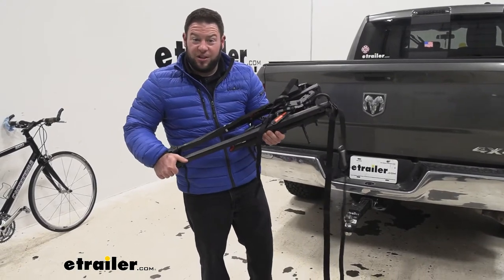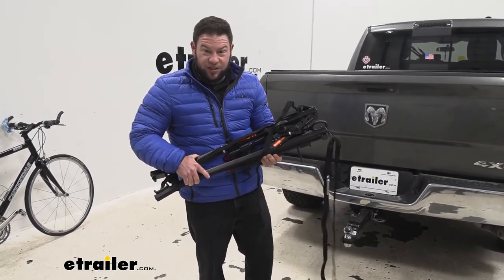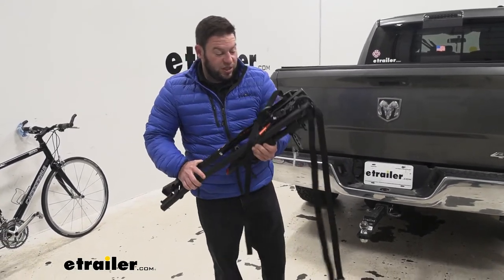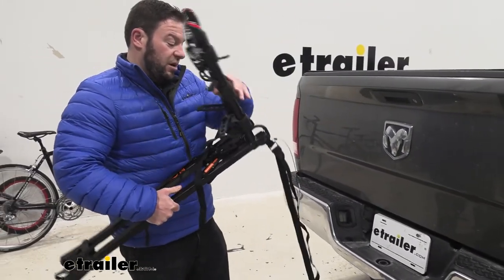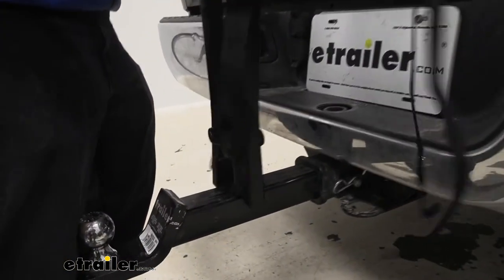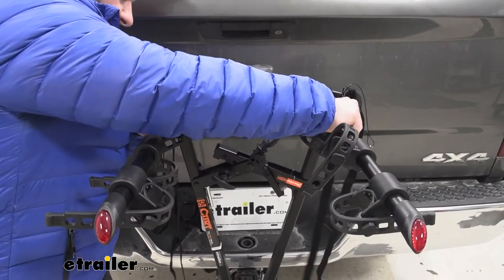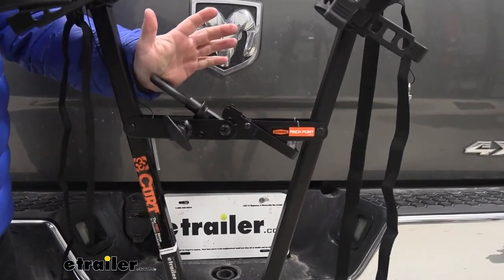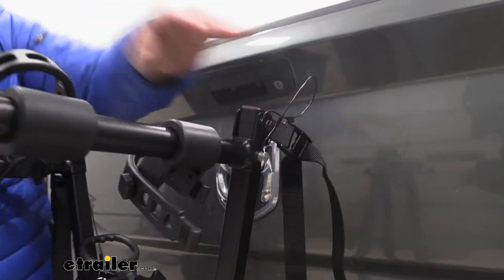Went ahead and removed the bike and took this off because I want to show you how easily this installs. First off, this is how compact it gets — it gets pretty small, which is good because you can easily put it in your garage for storage, the back of your vehicle, or even the rig you're towing behind you. It's lightweight, not cumbersome to pick up and install. To install: the arms fold back behind, so go ahead and fold them up front so they're facing forward, because once you put this down on the shank you can't flip the arms anymore. By pushing the arms at the top together, it opens up the bottom. Push on the arms to get it started, and then come back to the handle and push down to further secure it into place. Then come back and add the pins for extra stability on the arms.